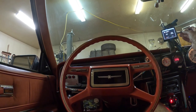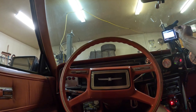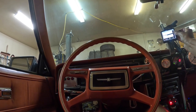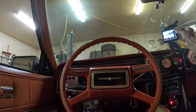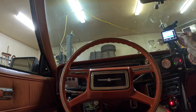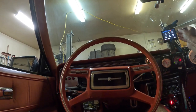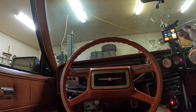Back to dash setup, dash three, okay, change channels - we want channel RPM, that's number two, engine RPM. This time for the gauge type we don't want the light bulb. We can see round tiny, digital small - we'll go round medium. You can see the preview down here showing an RPM gauge. The light bulb is basically just on or off. Round 90 degree shows a gauge with a 90-degree sweep. We'll go with round medium - click okay, save. Now if we go back to dash three, there's the big round RPM gauge.